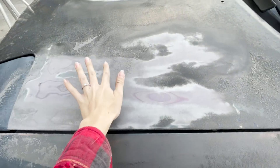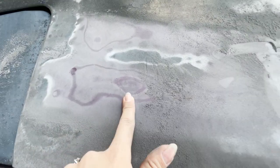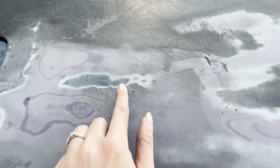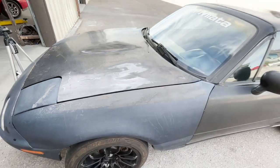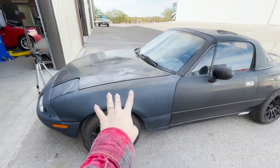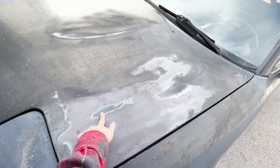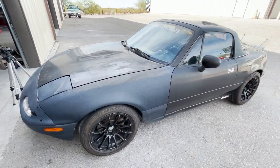The black is feathering out really nicely — it's just completely coming off easily. But I have this jawbreaker effect: it was this purple color a few times, there's the black still, and I think there's actually Montego blue underneath. Because this is flat enough and not flaking off, it'll be fine to leave. We're going to get an epoxy sealer for this so we don't have to worry about it too much — epoxy will adhere to almost all surfaces and make it nice and flat for one solid color.